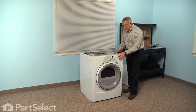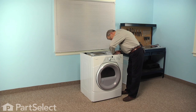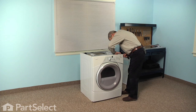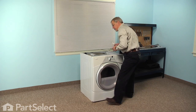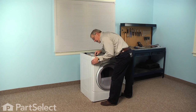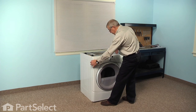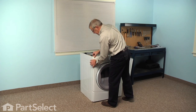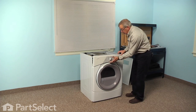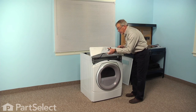Now on this model, we'll need to remove the control panel from the front. It has a couple of plastic clips inside that you'll be able to see that will need to be disengaged. Simply push them sideways to disengage them and tilt the console forward — you may need the long blade screwdriver to access those tabs. Then there will be three tabs across the top that we'll need to lift up on the console to disengage those.